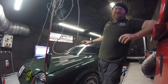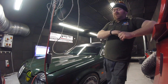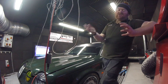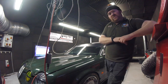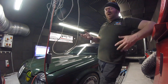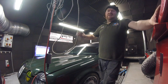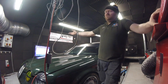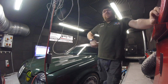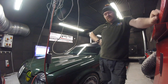We know we can run these with the Max ECU — we've done that, no problem at all. We know we can tune this with the Max ECU, we know we can run it, but we've got lots of stuff going on in the S-Type. There's rear body control modules, front body control modules — the entirety of the instrument cluster is run by a CAN bus system. So we initially considered running a piggyback system, which I've never been a massive fan of. It's done quite regularly and years ago I've done it myself. It's the quick and easy way of letting the OEM ECU handle all the CAN bus, and then we'd piggyback out the injector circuits and the ignition circuits and run them from the aftermarket system.